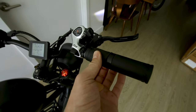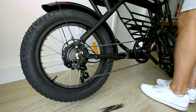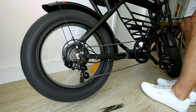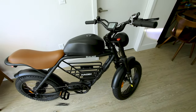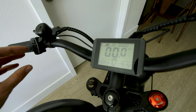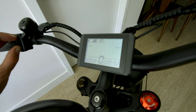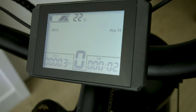Let's rip on that twist throttle a little bit. They say 1000 watts — this is pedal assist 5, full throttle. We're going to have to get in there and change some settings — it's topping the speed out at 20 right now. Actually they make this super simple: just hold the up and down button for about a second and it takes you to the speed setting. Out of the box max speed is 32 kilometers per hour which is 20 miles per hour.